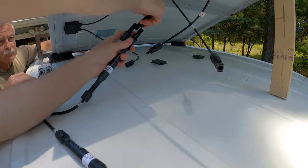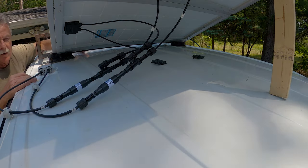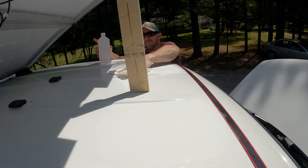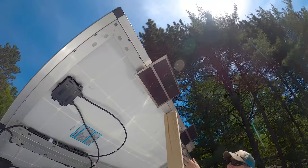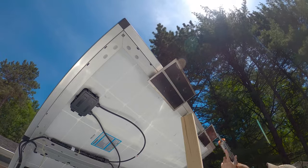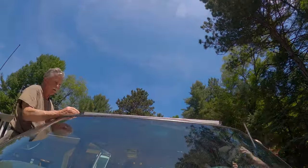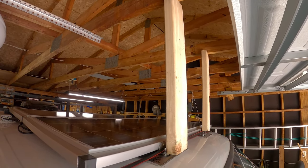Before I tape down the brackets, I'll make all of the electrical connections to the solar panels, using inline fuses for extra protection. I'll also thoroughly clean the roof. Between the strips of VHB tape, I'm using Loctite PL Max Construction Adhesive for another type of bond and to add overall strength. Now it's time to set these brackets down on the roof and let the adhesives do their job. These boards will ensure constant pressure on the brackets while they dry to create the strongest possible bond.